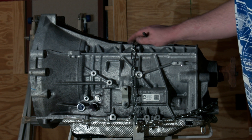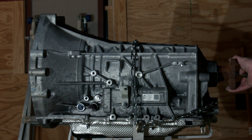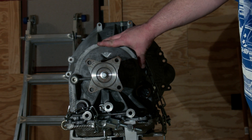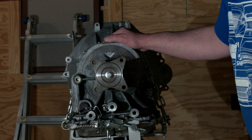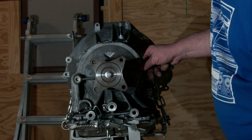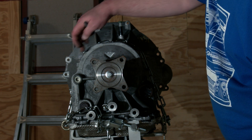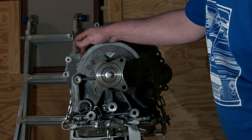One other difference between the 10R80 and the 6R80: the length from the bell housing face to the flange is about an inch longer, so you need about an inch shorter driveshaft, even though the mount is at about the same spot. The back of the 10R80 is also quite wide, and that wide section extends further back than on the 4R70W. The Panther platform tunnel is generous so we don't anticipate problems, but the 10R80 needs roughly another half inch of tunnel clearance over the 6R80.